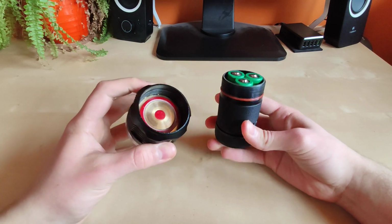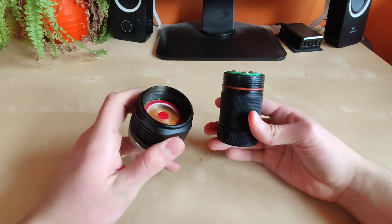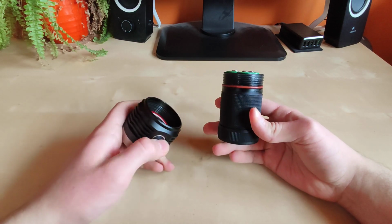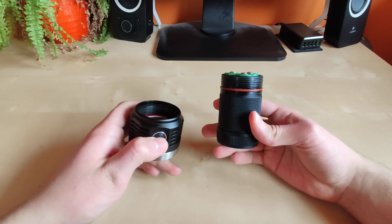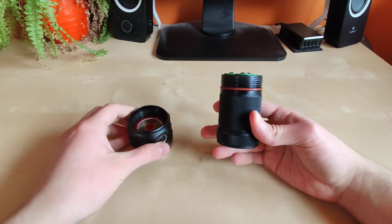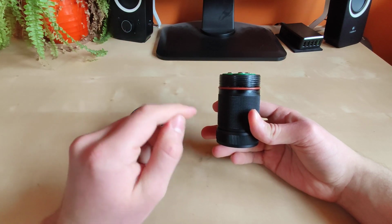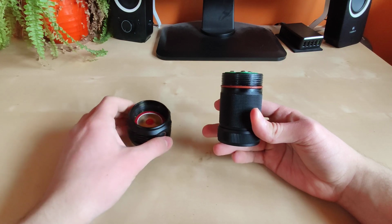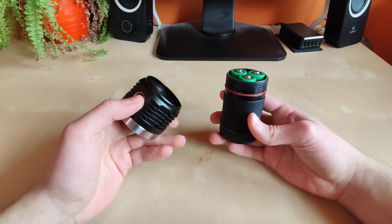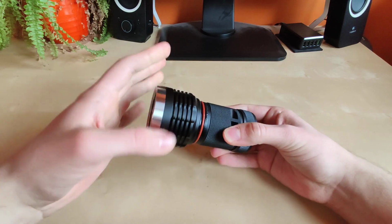So it might be the situation again that you can power this flashlight by 1, 2 or 3 batteries, and if you use the flat top batteries, make sure you check it, because it might be that actually one battery only is making contact and the other two appear to make contact, but when you put them in the charger you'll notice that the voltage of the batteries is different. So it might be that you're loading 3 batteries and actually using only one because of the broken contact.